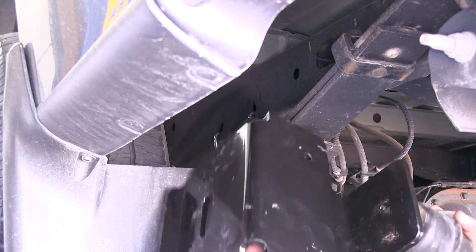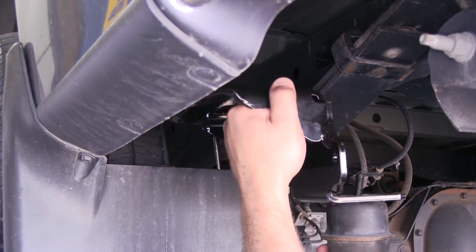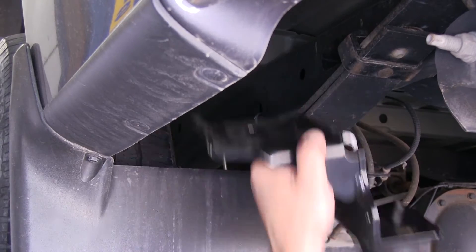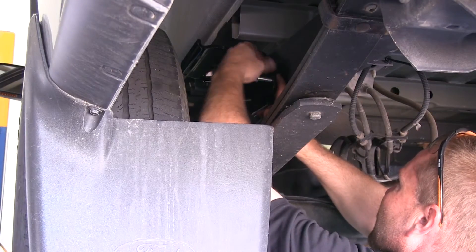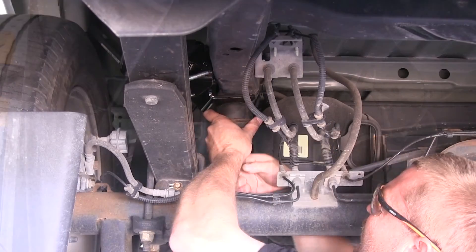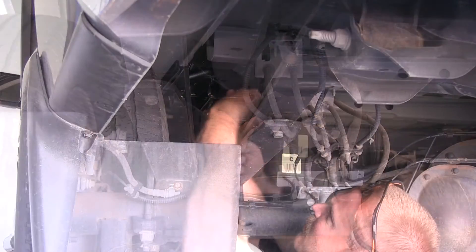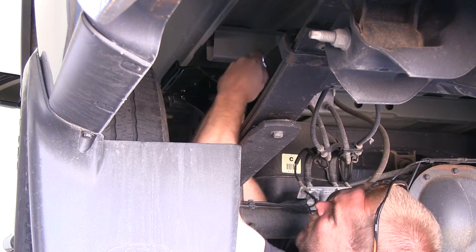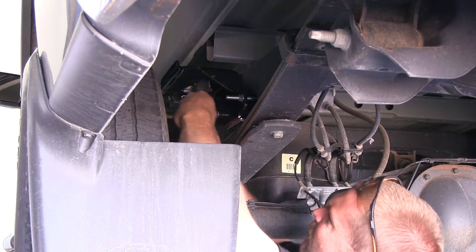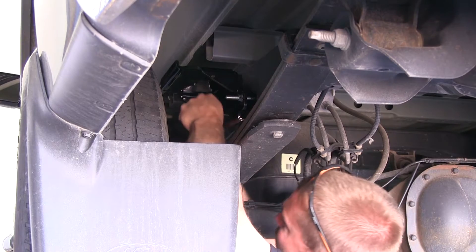We'll put the bolt and lock washer into the bump stop, then feed it through the hole in the upper bracket and back into the original mounting location on the frame. Make sure the two J-hooks are secured against the frame and that even pressure is applied as you tighten down the bump stop. Then take the flange nut and tighten down on the J-hooks — you only need about 10 foot-pounds of torque on each one.